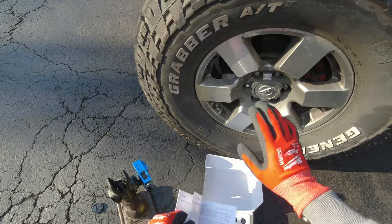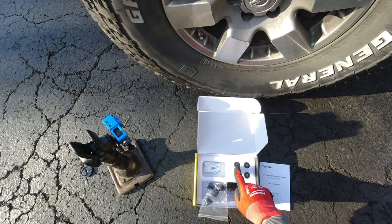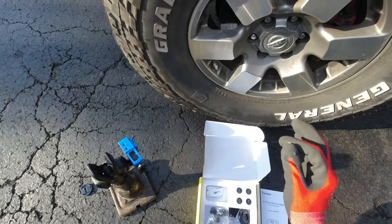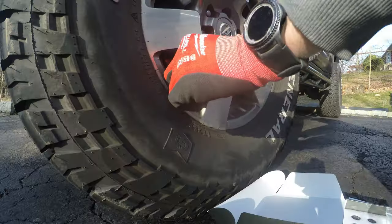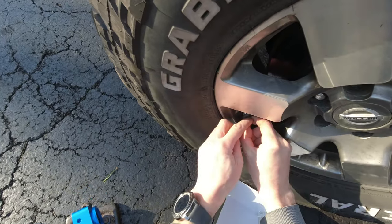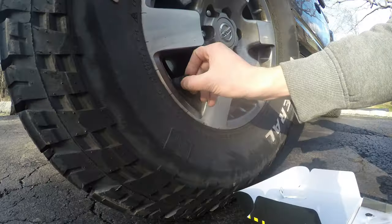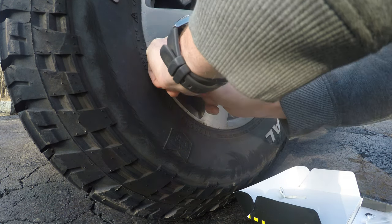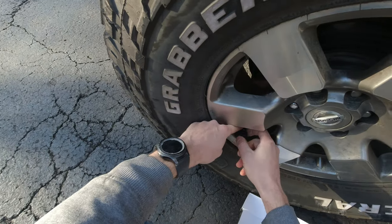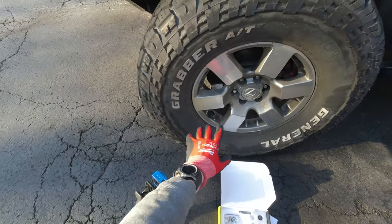Let's install all the sensors on the tires. To install the sensors it's pretty easy - just follow the instructions. They're all marked anyway: front left, front right, left rear, rear right. Remove the cap and keep it with you in the truck. Take the dust boot out and put it over the stem. Take the security nut and put it over the stem wall, then take your sensor and screw it in place. Make sure it's tight, then with the security wrench, tighten the nut all the way to hold it in place.